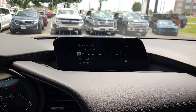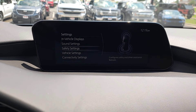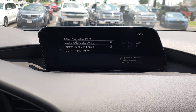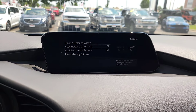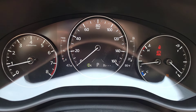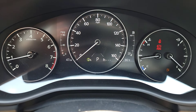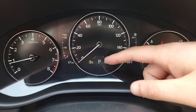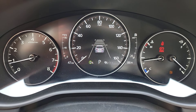Come over here to your center display screen. From there, go down to Settings, then select Safety Settings, then Driver's Assist System. The first thing that's going to pop up is Mazda Radar Cruise Control. You can see there's a check mark right there, so it's enabled. To disable that, you just simply push in — check mark's gone. Now it's just standard cruise control, so it will not slow you down to maintain that distance. You have visual confirmation because you have this icon — a picture of a speedometer and an arrow locking in place, meaning standard cruise control. If it's adaptive cruise control, as I just re-enabled that feature, you see it's a whole different icon — a picture of a car in front of the speedometer and the arrow — so now it will actually slow you down to maintain that set distance.